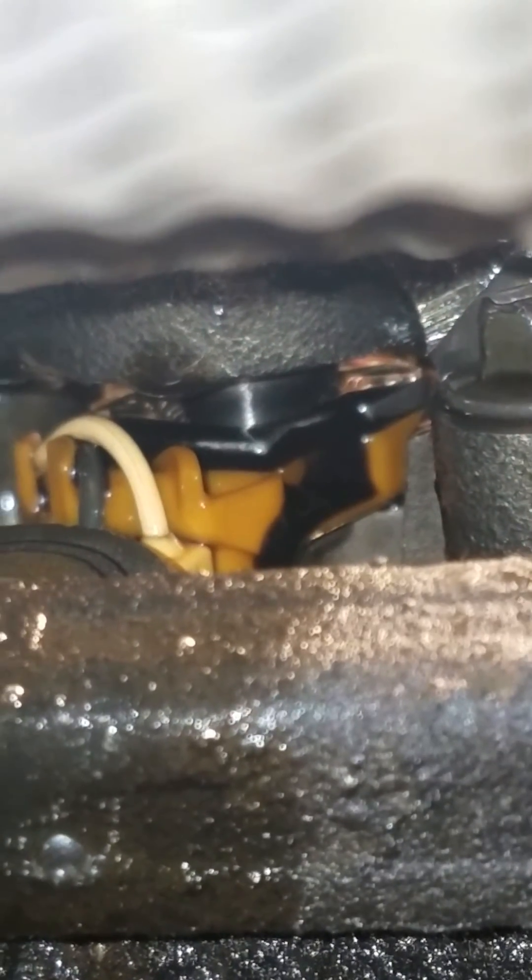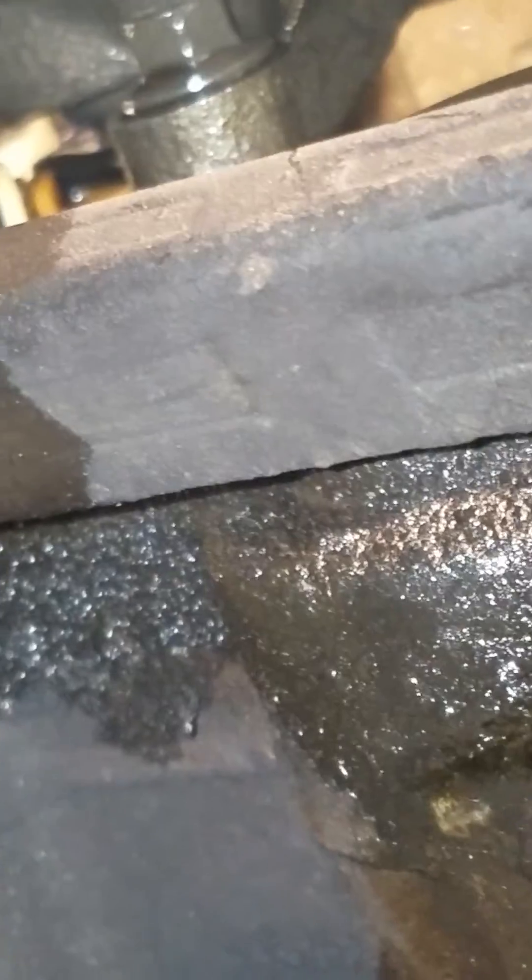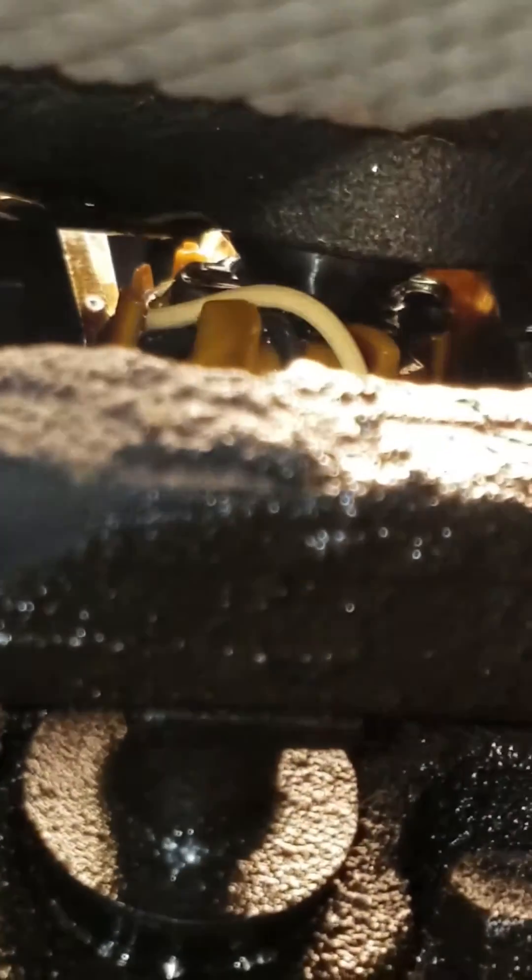You can see oil came pouring out of there, so we've got bad seals on top of the injectors. You can see it back there on seven, and I think it's also on three. So we're gonna go ahead and pull this oil rail off.